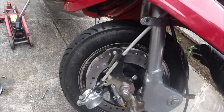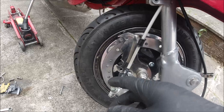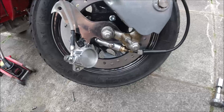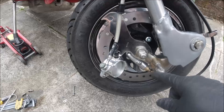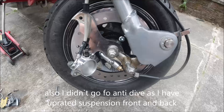What I'll show you is why I lock this plate so it can't move around. The last thing you want is for it to come loose and spin, then your caliper — or slave cylinder — moves up, and before you know it, if that bends, you're pulling your brakes and there's no fluid going through — you won't have any brakes. Also it can kill the speedo drive. It's buried under there but it's doing the job, stopping the main inner hub and the speedo drive from turning. If that turned around, the cable could break. It's just doing the job properly, as they should have done in my opinion.